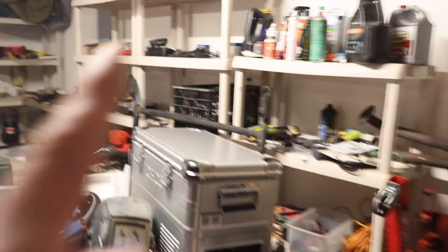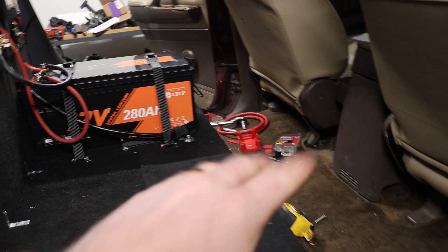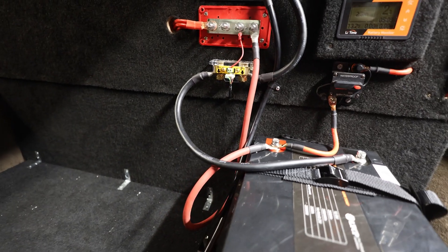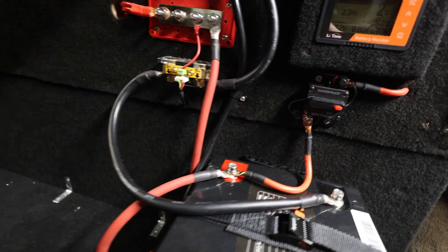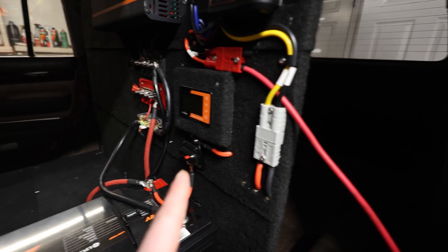There are lots of plans for the back of the Land Cruiser with a drawer system and I'm still figuring out whether to put the fridge in here, but there's plenty of room. I want to build another box to keep all my charging accessories, cords, cables, and batteries because when I'm out filming I have a lot of electrical demands. I've also run a two gauge wire from the negative bus bar into these seat bolt holes to ground the chassis, but the positive wire is a little too long so I've run out of lugs and need to head to the hardware store.